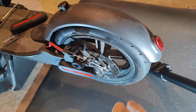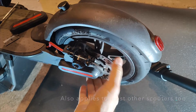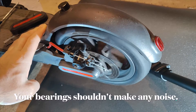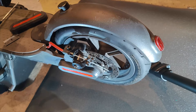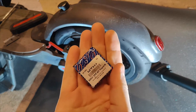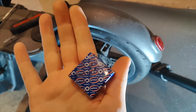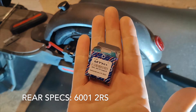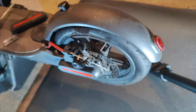This one's going to be about changing the bearings in this Xiaomi 365 scooter. I'm going to change the rear wheel bearing because it sounds horrible. We have various different types here — this one is 6002-2RS, that's the front wheel bearing, and 6001-2RS, that's the rear wheel bearing, and then various other sizes here just in case.